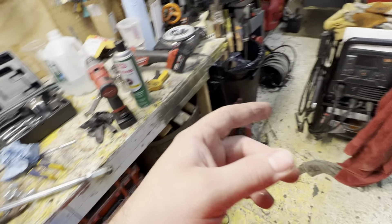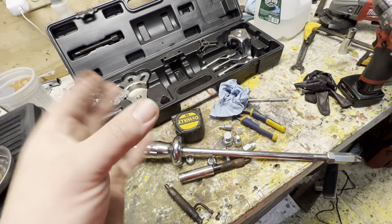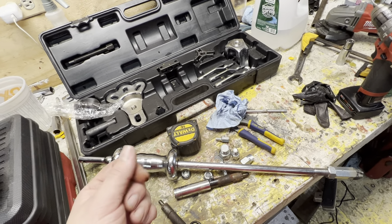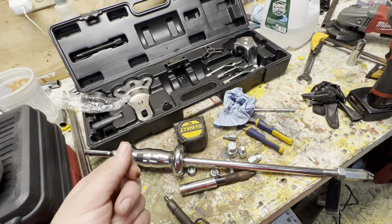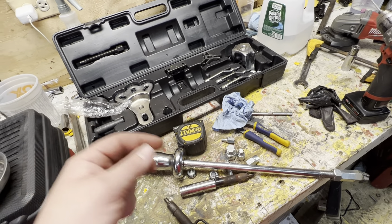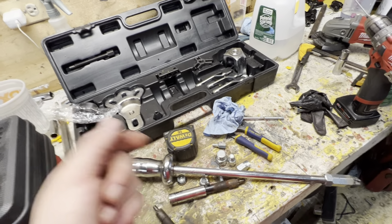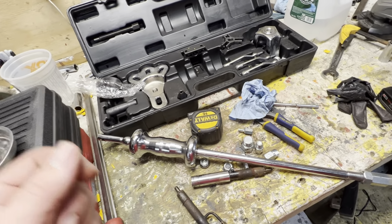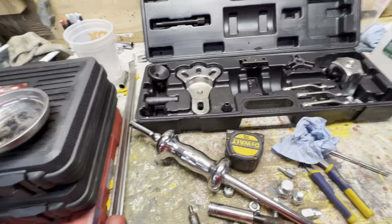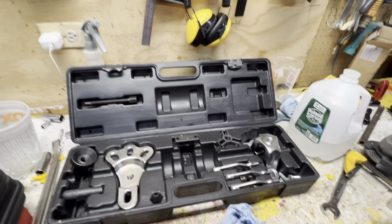I don't have the right kit to test fuel pressure, so tomorrow we're going to pull the valve cover and check the valve clearances, because that puffing the engine is doing could be a valve out of adjustment on one or more cylinders. Hopefully that gets it running right. I don't think it's piston rings since the blow-by is very minimal and it doesn't smoke out of the oil fill port, so I don't think that's an issue. I still have a compression tester on its way, so we'll check that when it arrives. I'll send another update once we get further along with this Yanmar engine on the TV138FR — thanks everyone for watching, like, subscribe, leave a comment if you want.